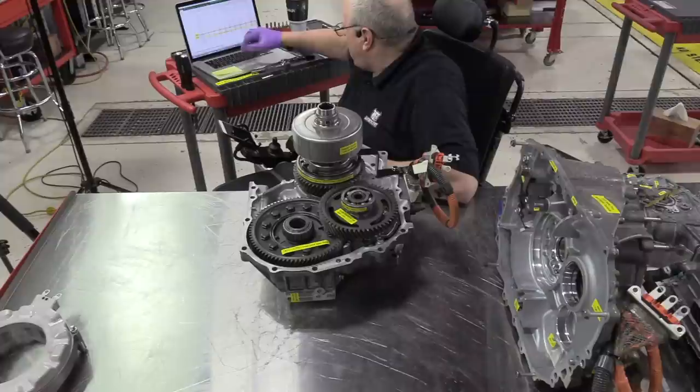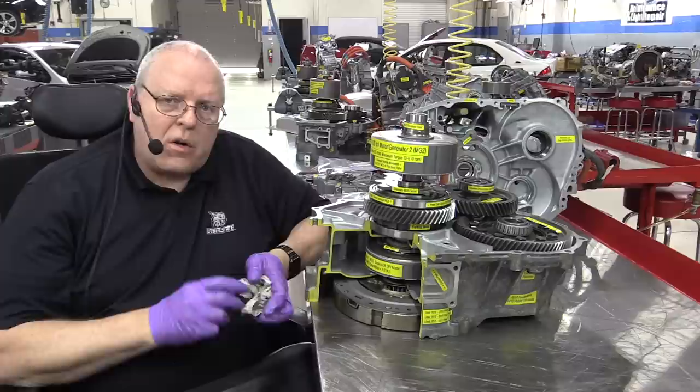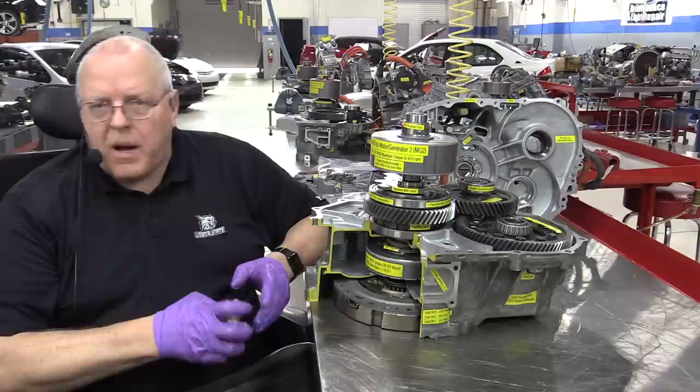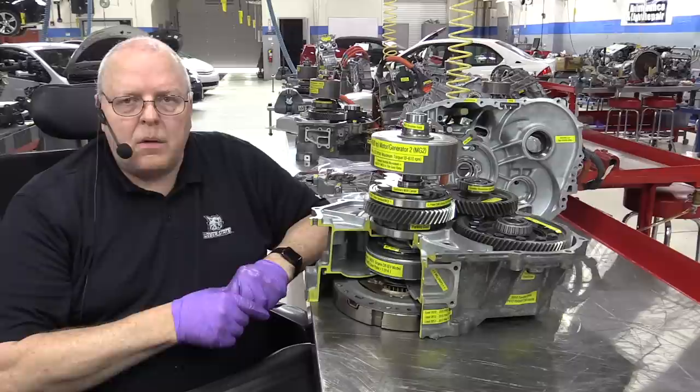with an engine speed of zero for the P410 transaxle here, the MG2 rotational speed is at 7,400 RPM. It's 7,400 RPM at 61.5 miles an hour. MG1 is at 7,800 RPM, which is nowhere near the maximum of 13,500. So it's not because of over revving. It's because we need more energy to propel the vehicle faster with the wind resistance and rolling resistance of the tires and so on.